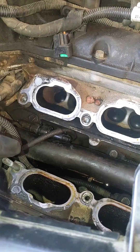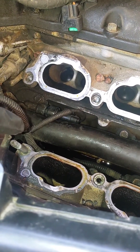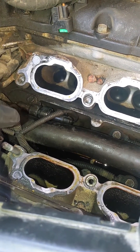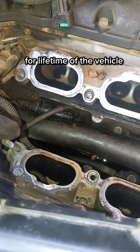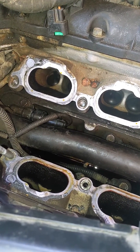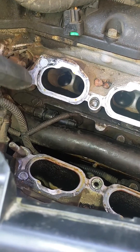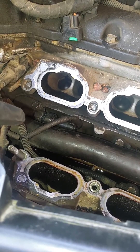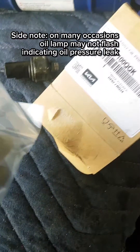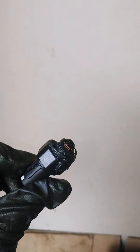It's OEM as well — they're $4 a pop, so very cheap, and they blow very easily. This is probably my 18th or 19th time replacing this sensor. Once it's replaced, it usually lasts about one month to six months. This seems to be the issue and Kia should improve the quality of their sensors — this is practically junk.